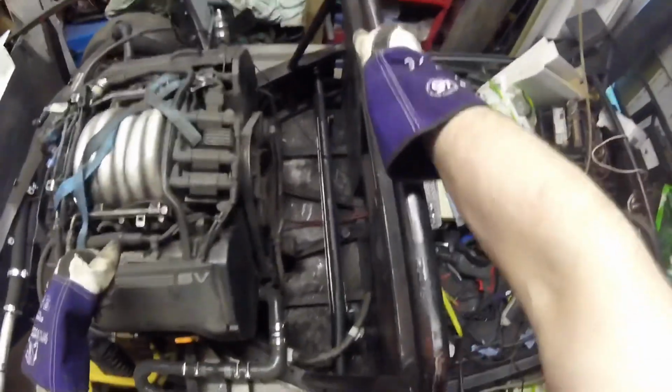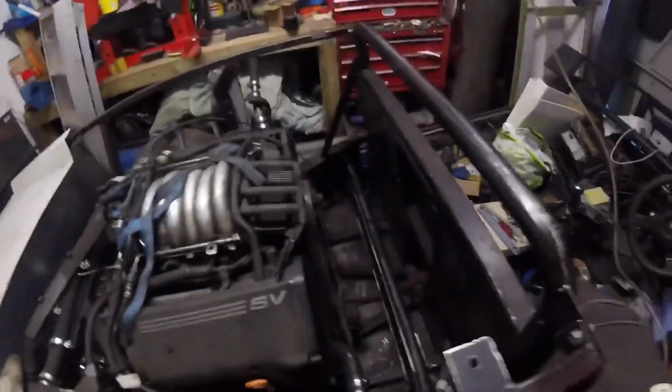Hold on there. There we have it. And I'll keep them level. This one here is fine. I can put clips around here then to hold them. So then that will be to the IVA approval, because every 300 mil you've got to have it clipped. So I can have them clipped across there. And yeah, that's our little bracket.